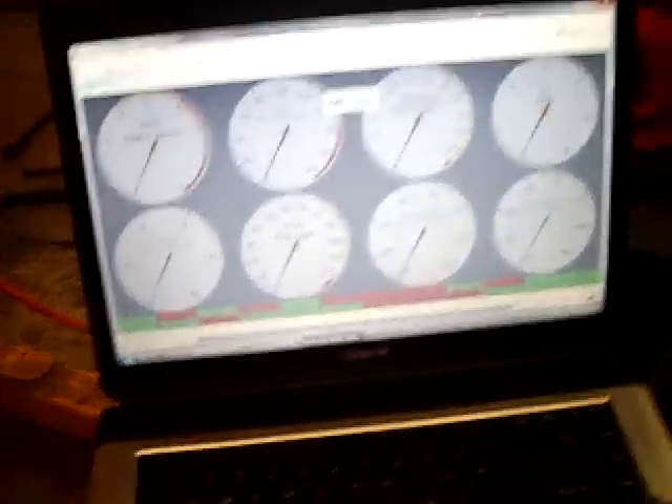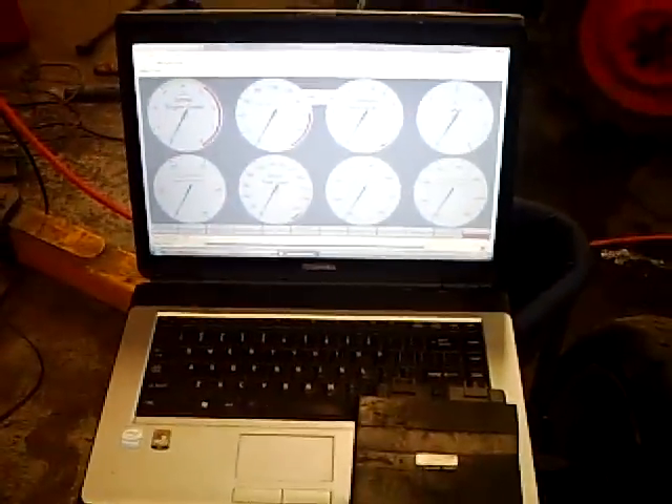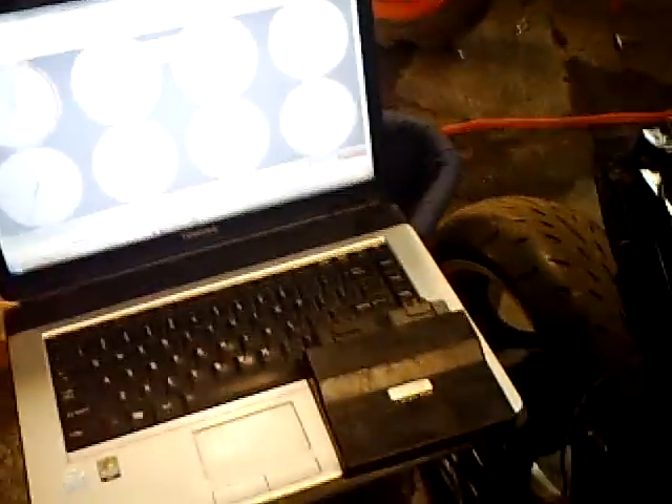Now this just has a base map out of a high boost tune in it right now, so it's definitely not anywhere close to being tuned, but it starts up fine. It needs some idle mixture adjustments and some upper end adjustments, but enough to get going at least.